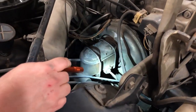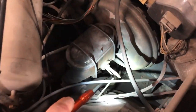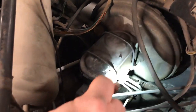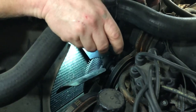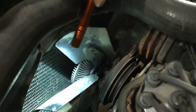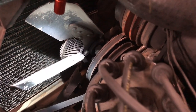This big tube-shaped thing is a vacuum-operated air compressor — what would have run the air suspension if it were operational. I'll probably take it off and, when I decide to restore it to original, rebuild it and run new lines with air shocks in the back. Here's your brake master cylinder — make sure no lines are missing. It's not uncommon for a seller to block off or pinch the rear brake line if the rear brakes are leaking. Make sure both lines are there and that neither reservoir is extremely low. You can also peek at the radiator through the fan to check for pinholes or past repair work.